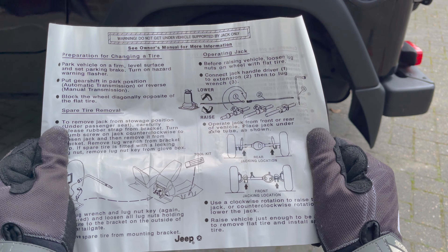Take your owner's manual or jack instructions manual and look for your car's jacking points. Don't jack the car up on a random spot — you might damage it. Once you've verified the jacking points, place your jack in the right position and lift the car up. Only raise the car until the flat tire is about an inch or two from the ground, and make sure the opposite tire is still touching the ground.